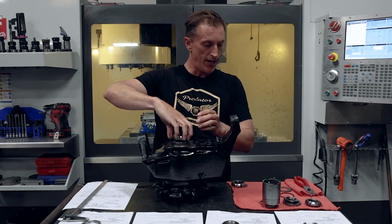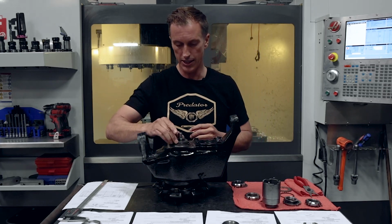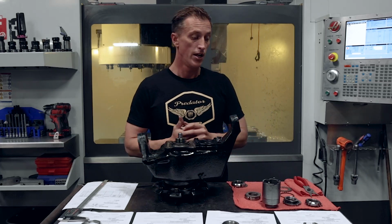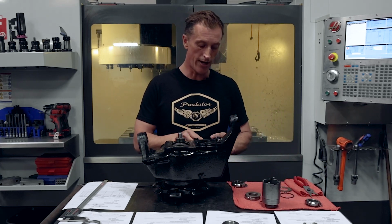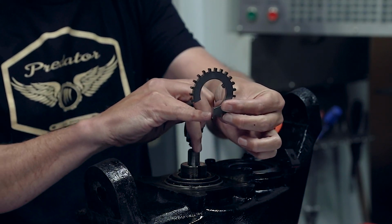and specifically how this failed. This is an aftermarket company that offers these locking spindle nuts, and there's a lot of hype as far as their locking spindle nuts. In reality, they're not locking spindle nuts at all. I would call them a retained spindle nut, but really nothing more than that. So we did a chemical analysis, that's why we're missing a section here.